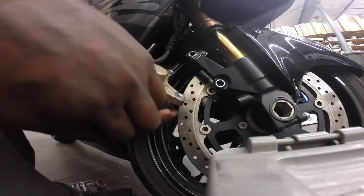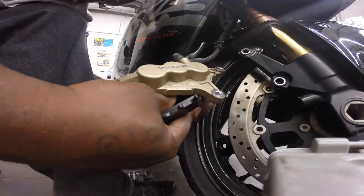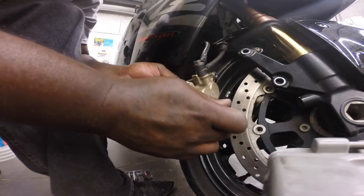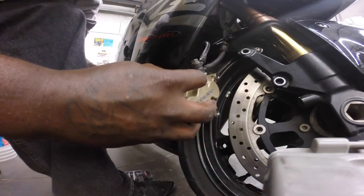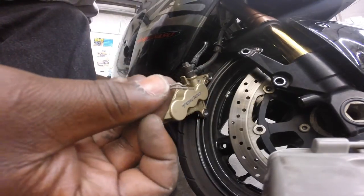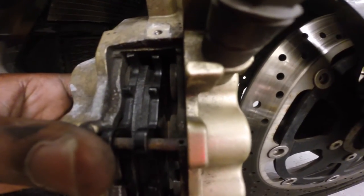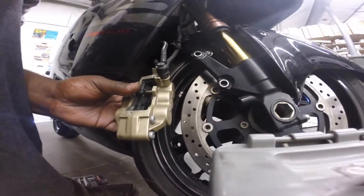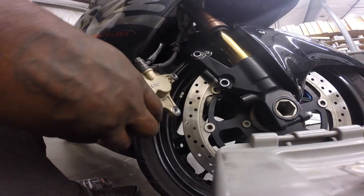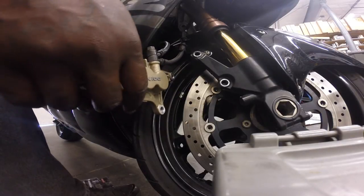Here are my new brakes. All you want to do is just slide them in. Got my pin — slide your pin back in. Remember this little cotter pin: there's a little hole right there. Spin it around if you have to — that's where your cotter pin goes. Slide it in like this. It's in there, it's not going anywhere. Now put your brake dust shield back on.